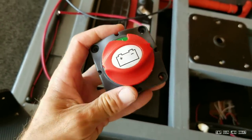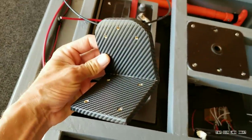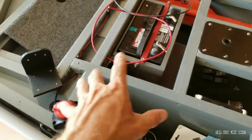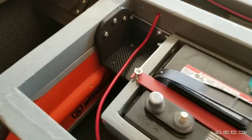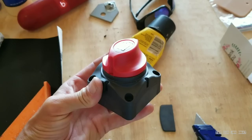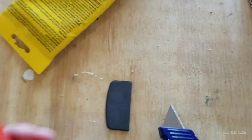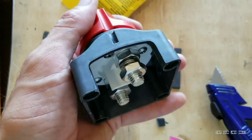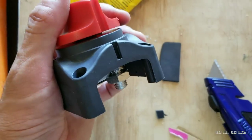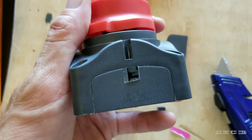I'll leave the link to this in the description of the video. This is just going to kill power to the battery — it's a marine grade switch. I'm going to mount it on this custom bracket that I fabricated, and that's just going to go in here. I'll mount the bracket and then wire in the switch. On this switch, there are plastic parts on the side that simply slide out and give you access to run your wiring. What I've done is just taken my razor knife and notched out a little notch for my eight-gauge wire to slide through so it contains it a little bit better.